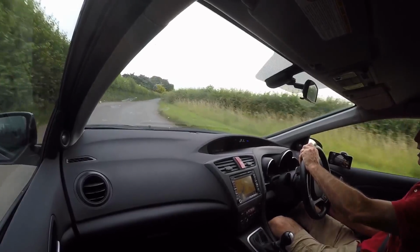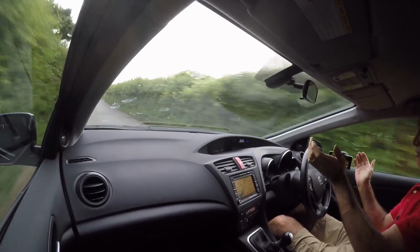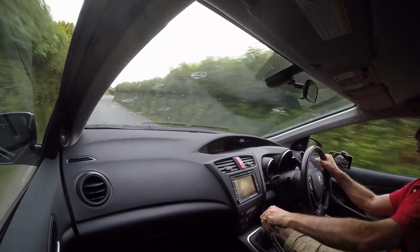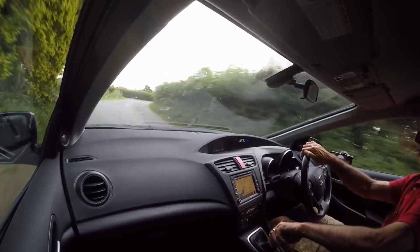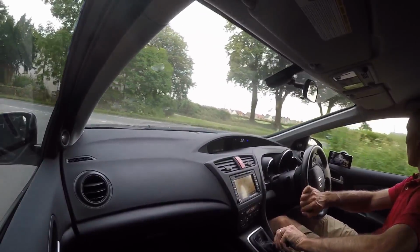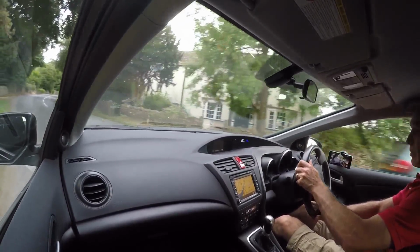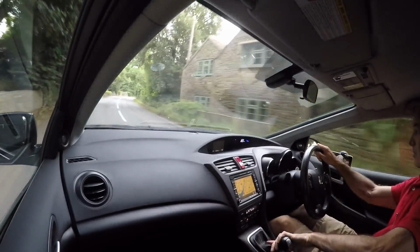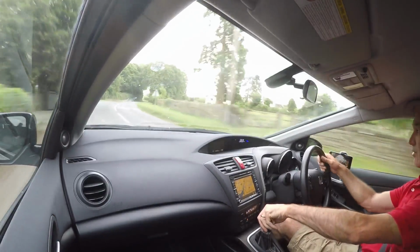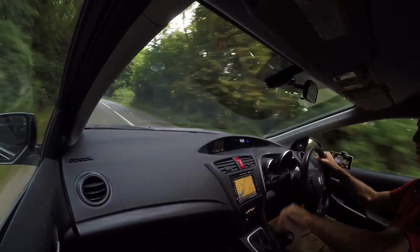Steering the vehicle, tight, taut, tracks absolutely bullet straight. It doesn't vary from the line ahead, so clearly tracking's in very good order as well. What I'm looking for in the video is kind of signs of wear, things that you occasionally get in a car, even of this age, where you might have a little bit of looseness in the steering of the vehicle. There's nothing, it just feels absolutely crisp and tight. It really is in very fine order indeed.